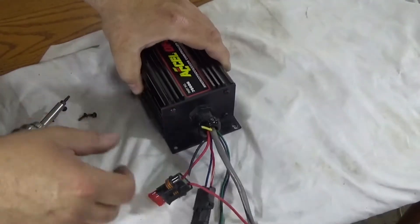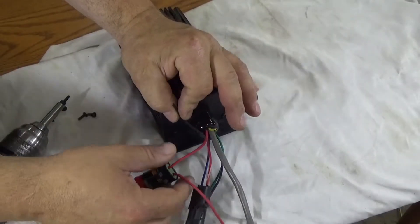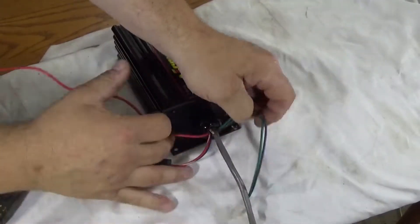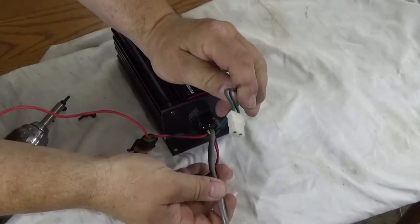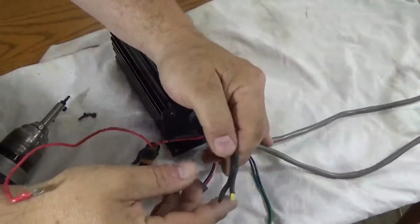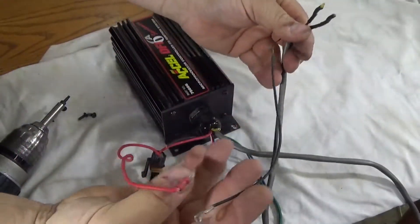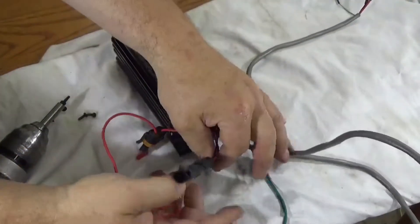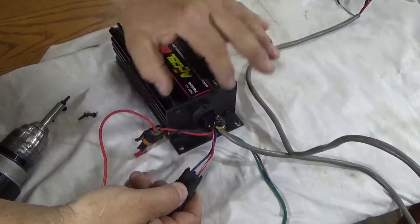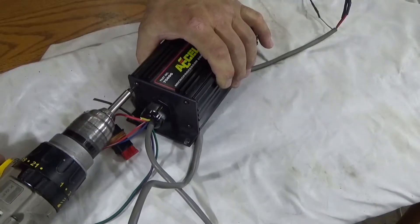I took this out and they're all pretty much the same. You have a wire that goes to your tachometer, a ground and a positive that gets hooked up to the battery side. This connects to an inductive type ignition system like a sensor on your crankshaft for rotation. You have a positive and negative that goes to the coil with a ground, a switched 12-volt source, and a trigger — this is what the computer triggers this box with.